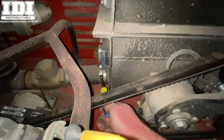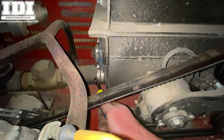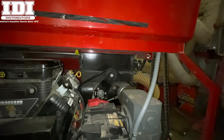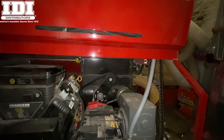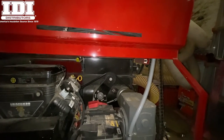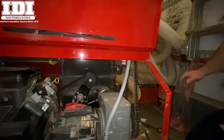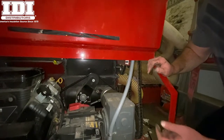These clamps here — we're going to need to disconnect those. That hose is where the air pressure comes into the airlock. We need to disconnect it to break the airlock free so we can pull it out. Both this seal and that hose are going to be attached to the airlock pretty tight. Sometimes the airlock will pull out easily, sometimes we're going to have to break it free manually. We'll try pulling it first — this one's stuck in there quite a bit, so we're going to work on getting that hose off the back and breaking that seal.